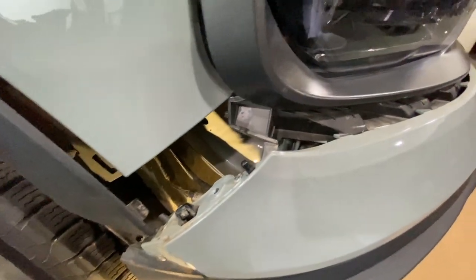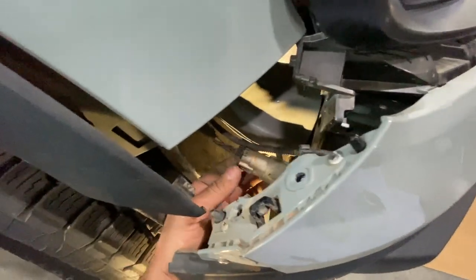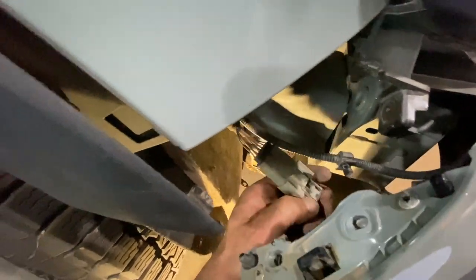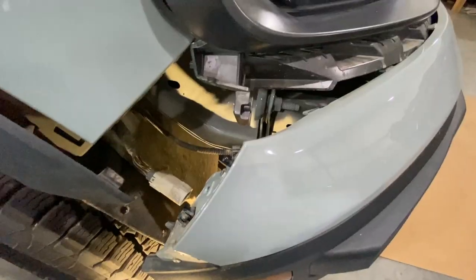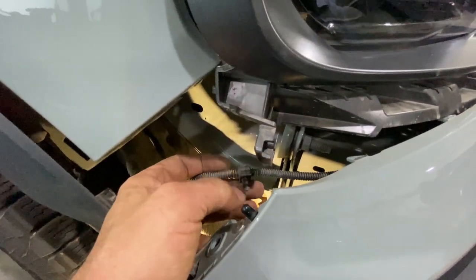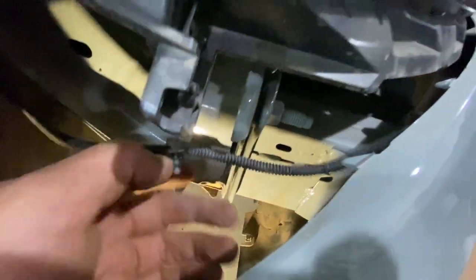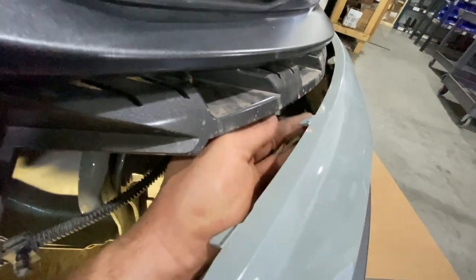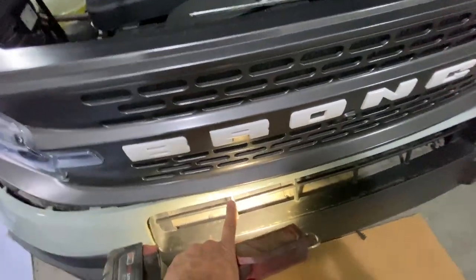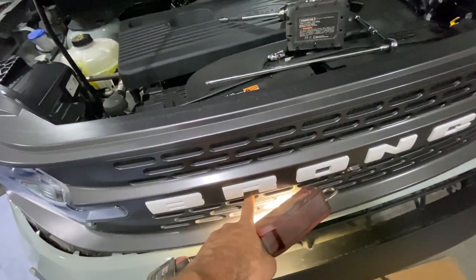Pull here and undo the clips from this headlight bezel, working your way across. Once you have it to this point, don't pull too hard — it actually came loose all at once and pulled a little further than I wanted. At this point you have to deal with the wiring harness, which is just this little plug right here that goes to all the lights. Just press in on the little release clip and pull — there's your wiring out of the way. One last thing: this is the washer fluid tube for the front camera, and we have to unclip this from the bumper. Just pull on these little clips and it'll come loose as you pull the bumper off.